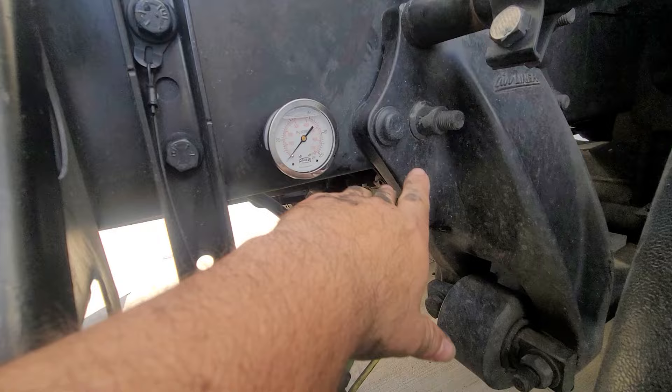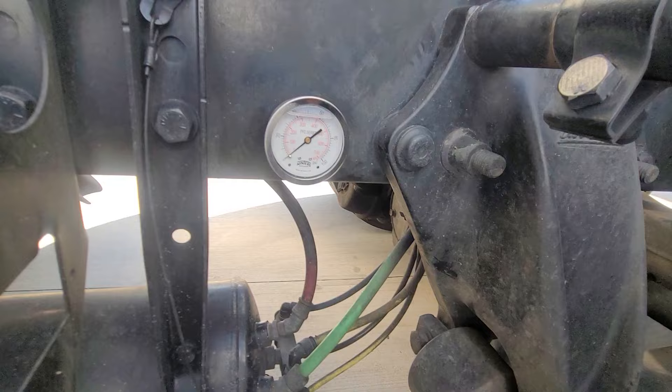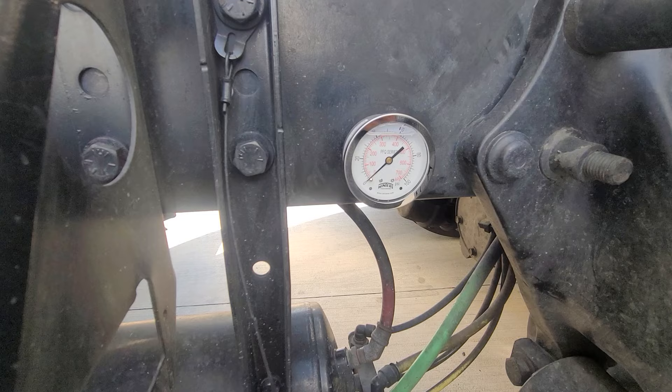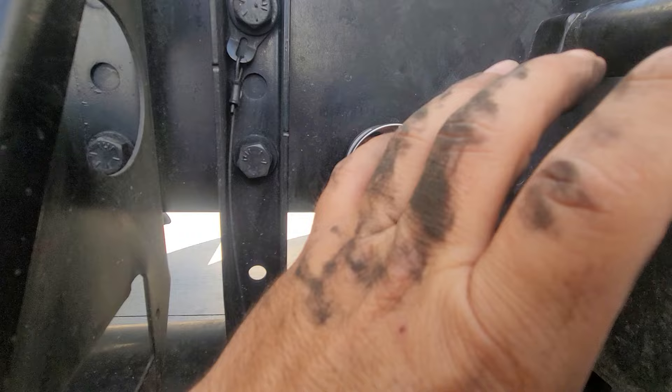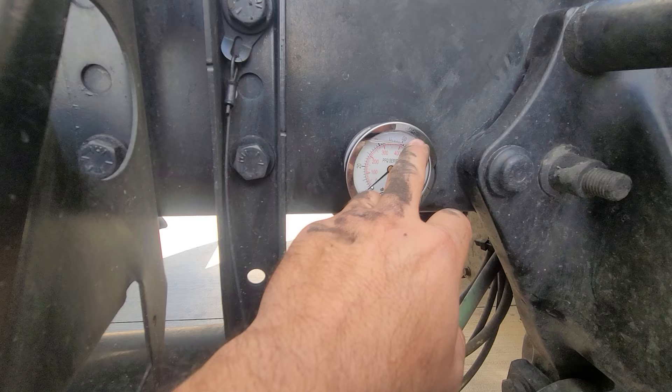Make sure you do your own test on your truck or trailer — it's basically the same thing. Once you put the gauge on and once you get loaded, go get a scale ticket and check where the max is going to be when you have a heavy load. When you've got like 34,000 pounds in the front and back, you'll know what the max on the gauge should be. For this truck it's around 60 — no more than 60.